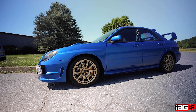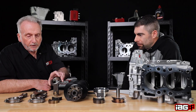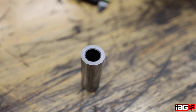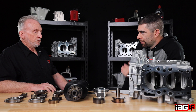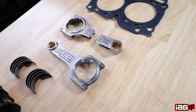What is the major difference between our Stage 2 and our Stage 2.5 for internal components? Going up to the 2.5, we step up to a beefier H-beam rod compared to the one we use in our Stage 2, and complement it with a thicker wall wrist pin. The 2.5 uses a 0.210-inch wall thickness pin, and it's also 9310 steel. We're using the same piston as our Stage 2 — just beefing up the wrist pin and the rod. Same stock crank and same bearings, with clearances adjusted as horsepower goes up.